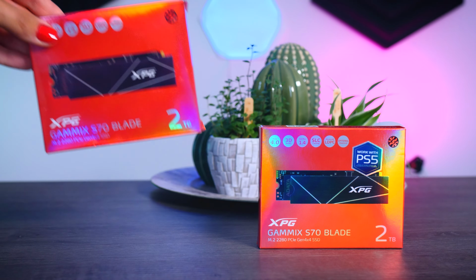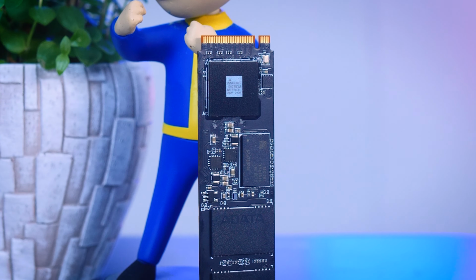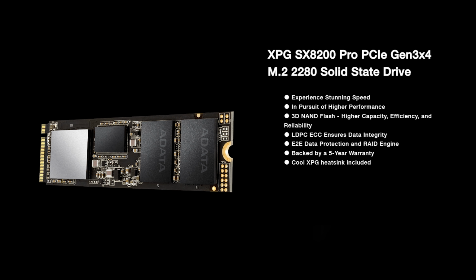While it's actually pretty common for an SSD to change a little bit over a period of time, usually because the supply of memory modules changes as well, some manufacturers just decided to intentionally cost down to much cheaper components, which then resulted in drives that were performing completely different from what reviewers had tested. And Adata was actually one of the worst offenders there. With their previous high-end SX8200 drive, they changed pretty much every single component several times without ever changing the product name or even just calling it a revision. So you had absolutely no idea what you were buying.